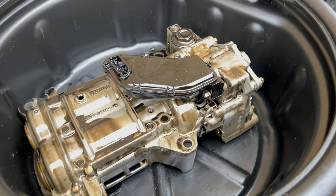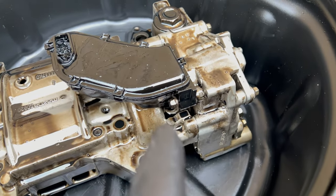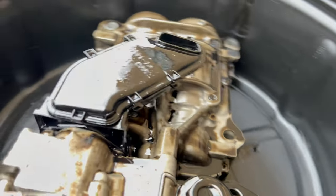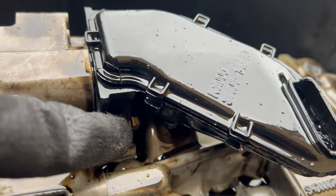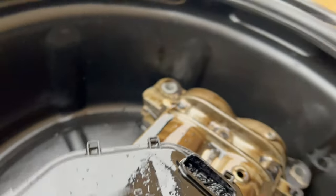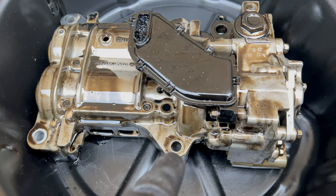Here's why: if you are replacing the oil strainer you always have to remove the oil pump and the balancer unit, because the strainer has two bolts. One is an eight millimeter bolt you can access easily, but the other bolt is right there — if by any magic you can fit a spanner on it it's fine, but you cannot undo it all the way, hence you cannot remove the oil strainer in situ.